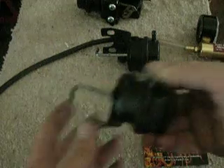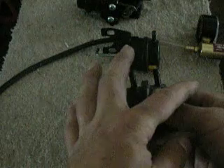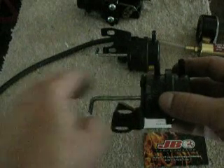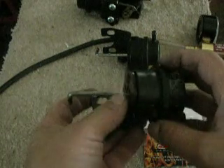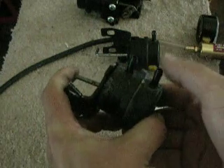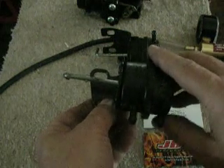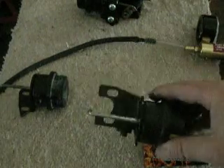This one has two ports. One is to pull it back, and the other, as a suction side, is to retract the lever. Sometimes they have a port on different cars that will actually pull the lever closed — in other words, to close the bypass valve in case there's a low vacuum condition. So I'm going to push this lever all the way in, block the suction port, and watch when I let go. The lever actually comes out — this is a good one.